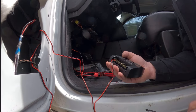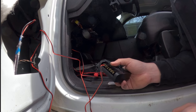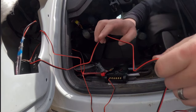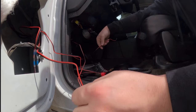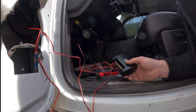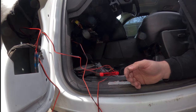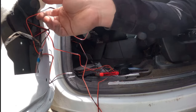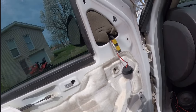Now the input is done. I'll grab the tweeter wires next — pull to see which one responds. Leave a little more slack in the door for the tweeter since it's got to go all the way up. Once all three are together, I'll turn on the radio and test everything before slapping it all back together. I'll run the tweeter wire up through the door, hook up the tweeter, and if everything checks out I'll start reassembling.